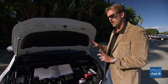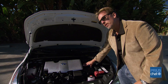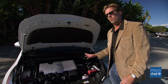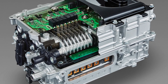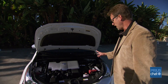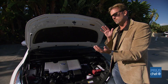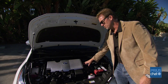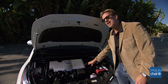It's a little difficult to see, but I'll start at the top and work down because the inverter — our power control unit — is right here. Compared to previous generations, this new inverter is about one-third smaller than its predecessor. It's lighter and more efficient. Do you see any orange cabling running around under the hood? No. We have a new transmission assembly underneath, mounted directly to it. The high-voltage connections are made directly. By losing the cable, we reduce electrical resistance and our electrical current loss to heat, so we get more efficiency out of this too.